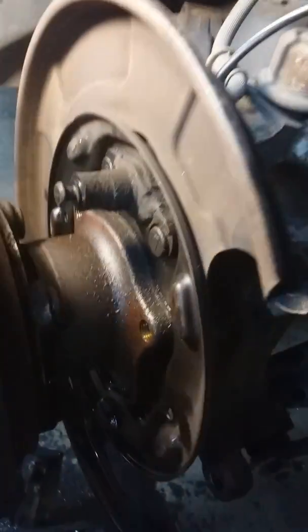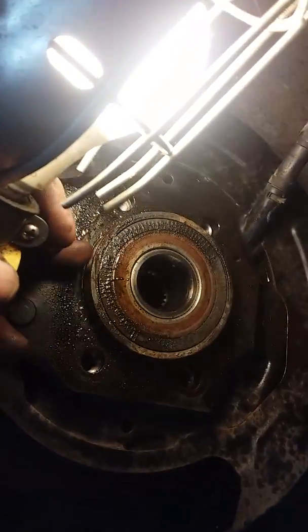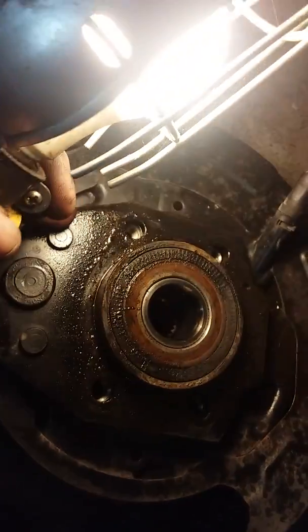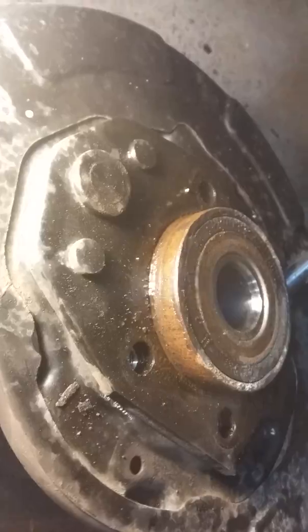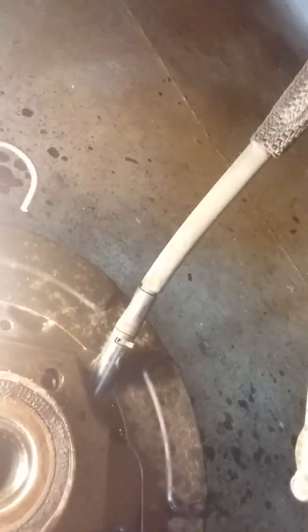This one's a little stuck, so I'm going to go ahead and get the parking brake cable off. Usually it slides out of here. The hub itself has to slide out of this thick bracket — that's actually your mounting for the wheel bearing. To get it out of there, I'm going to disconnect the clip right here on the parking brake cable. I'll disconnect it from the parking brake itself, which I've already done — you can do that by hand.